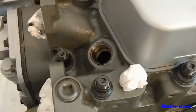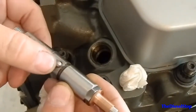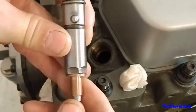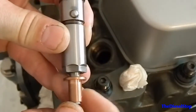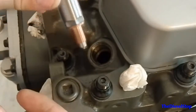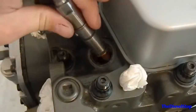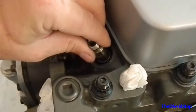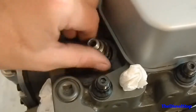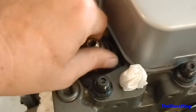What we're going to do here is install these injectors. There's a little ball bearing that sits in the front right here. Behind the sleeve I've put just a very light dab of grease to help hold the adapter sleeve onto the injector so when you turn it upside down it doesn't fall off. This little bearing goes towards the front of the motor — there's only one way it sits in there. Once it pops in we put the retaining nut on, and these retaining nuts torque down to 45 foot-pounds.